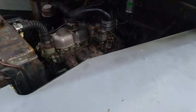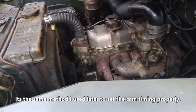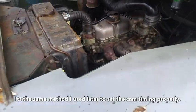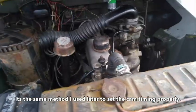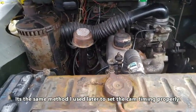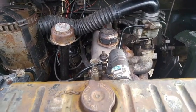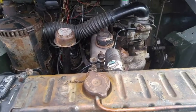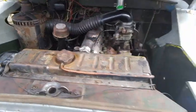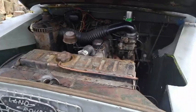I did it using the two-line method, dividing that in half on the crank pulley, and you could tell it was slightly off. I lined up the exhaust peak mark on the flywheel with the pointer, and with the indicator on the number one exhaust valve, it didn't reach peak until after I turned it past the exhaust peak point. So it is definitely delayed.